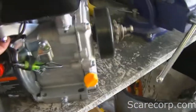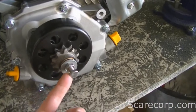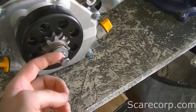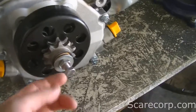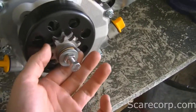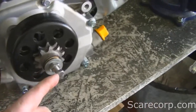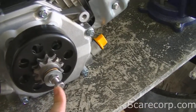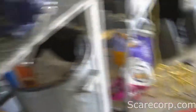The centrifugal clutch — I still need to get a nice bolt that fits. This is the right size but it's the wrong threading, so I just kind of put that on there to keep it from falling off while I do my measurements. I believe this is a 5/16-24 threading.